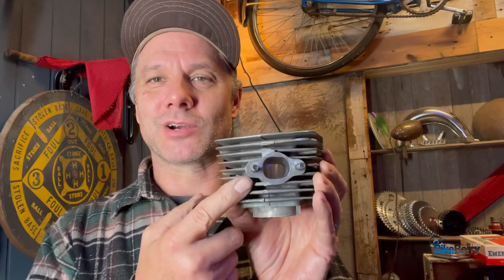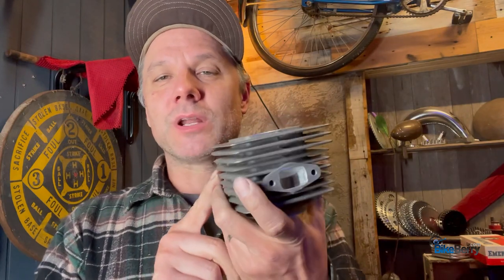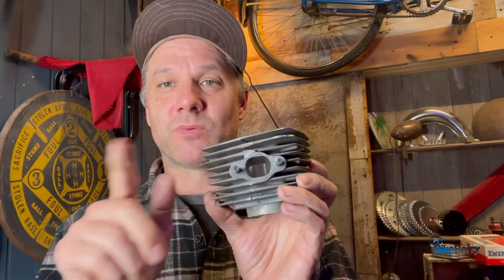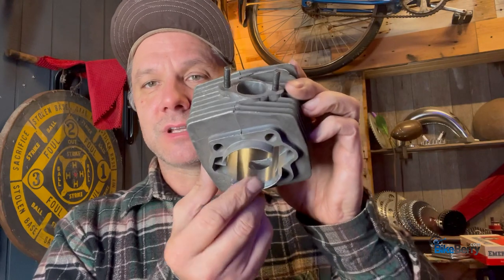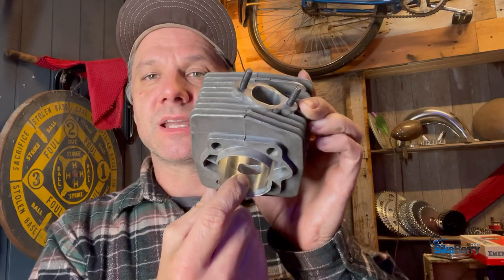Well, hopefully that encouraged you to bust out your rotary tool and start grinding on your cylinder. Get those ports opened up, get them smooth, get them functioning the way they should be so you get optimum performance. So what we're going to do next, in the next video coming up, is chamfer the edges because we want maximum flow in, right? And maximum flow out. And then also in your ports on the inside, let's see if you can see those right there. We're going to chamfer those because we don't want the rings on your piston to get snagged.